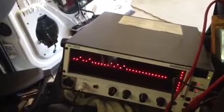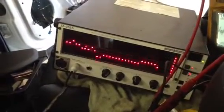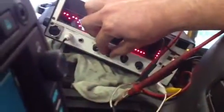So what happens as you turn the volume up on the radio, it actually cuts bass away. Very important thing to know when we are adding aftermarket equipment. As I turn the volume back down and readjust my RTA so we can see it, you'll see that bump come back at low volume.